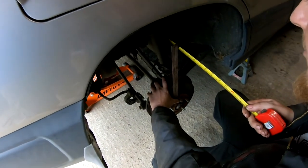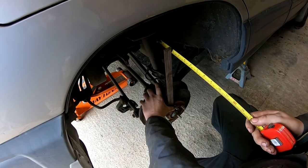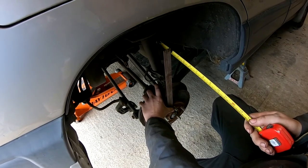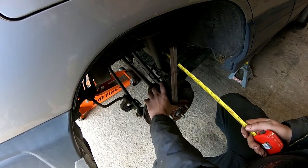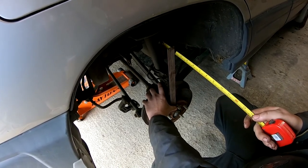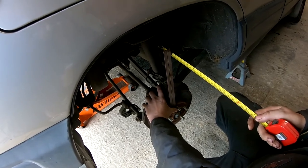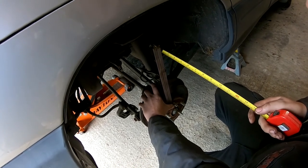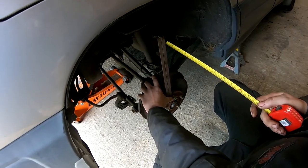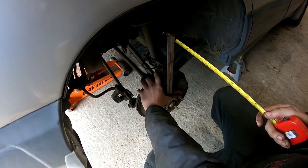And it's going to have 4 inches back spacing. So it'll be about like that. I think it'll clear on the inside. See how far it is inside there? And then we did another inch spacer. It'll pull it out to here. We definitely should have clearance with that. And so the rim's going to be out here where my number seven is. So, what do you think?